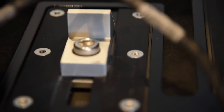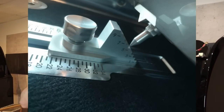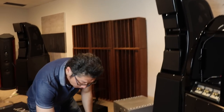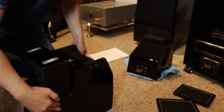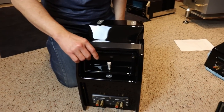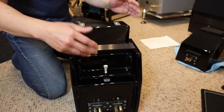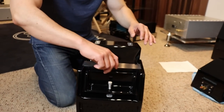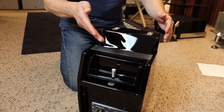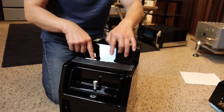That angle will be determined by how tall you are and how far you are from the speakers. Once you've done that, the tweeter itself gets adjusted. You'll see this bolt or post — you loosen it and the whole tweeter module will move in or out according to where it needs to be.